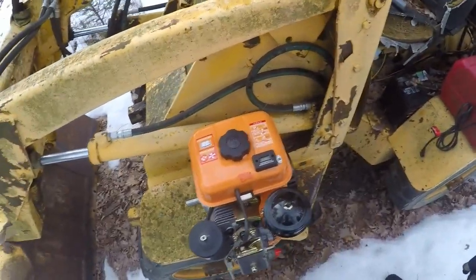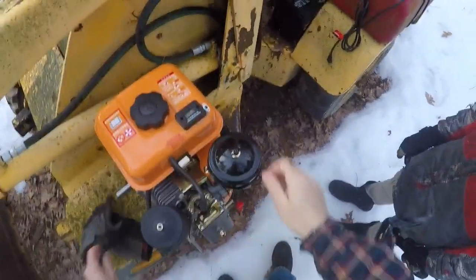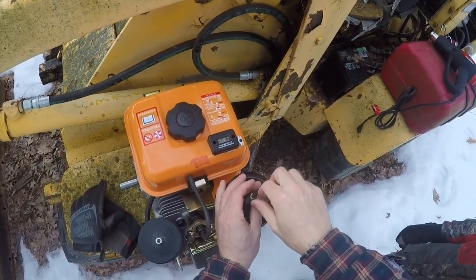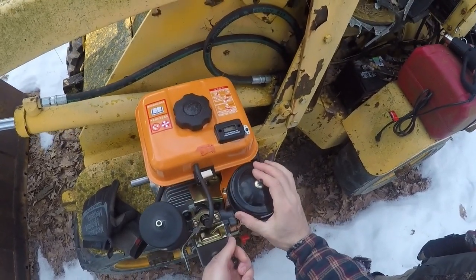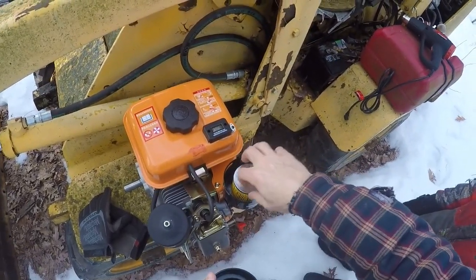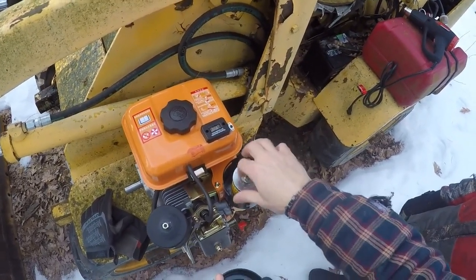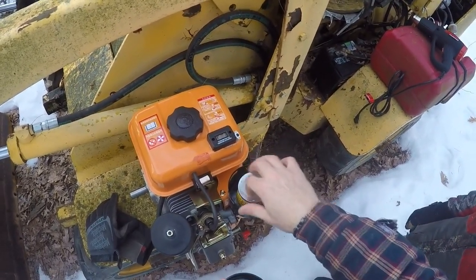One thing you want to do before you start putting heat on here is remove any elements that are vulnerable to heat damage. Your air filter element in there, it probably would be okay. You could probably heat it, but we're not going to take our chances here because I don't have spares. This being from China, I don't have a lot of spare parts for it in terms of filters and things like that. So we're going to go ahead and take those things out of here, including the gasket that's underneath the air filter. And then at that point, we'll just be heating steel components, which are certainly capable of taking the heat.